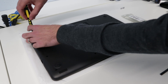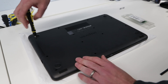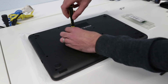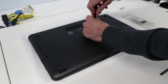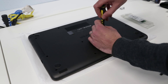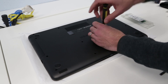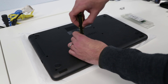We've gone with this model and we're upgrading it to 8 gigabytes of memory. I intentionally bought the base spec first because I didn't feel the upgrade to 8 gigabytes was particularly good value, and it was a lot cheaper to buy an additional module myself and fit it. Obviously this has an impact on the warranty, but also the 8 gigabyte version only came with a single 8 gig module, and because I want to use this laptop for performance testing with integrated graphics, I'm going to be testing in dual channel configurations.